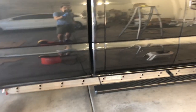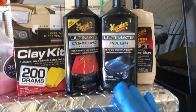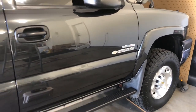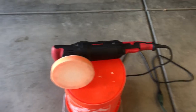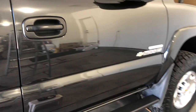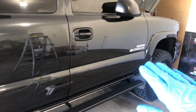That's about everything you're going to need. You could just polish by hand — put it on a round microfiber circular pad and work it in — it would take a lot longer but you can still polish out scratches that way. The dual action polisher saves you a lot of time and it doesn't take a professional to learn. Quick shout out to Scott if you're watching this — thanks for teaching me how to do this. I'm not sure if you can tell, but this front fender and passenger door I've already done, so those have been polished.